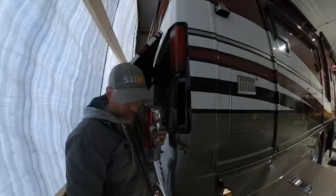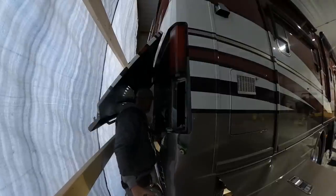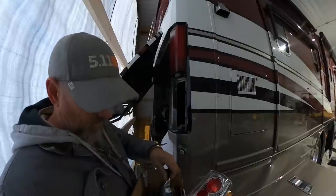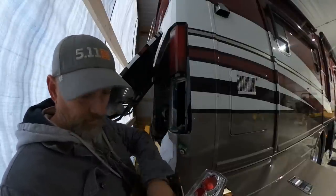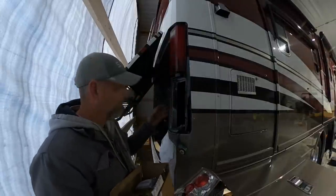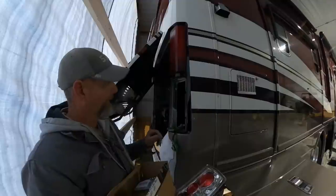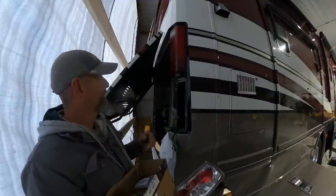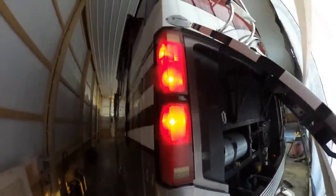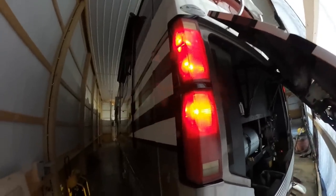When I pulled them I realized those are the old bulbs, so I ordered LEDs — 1156 and 1157 bulbs, plus the same blinker bulbs because those were so powerful back there. You can also use them as reverse lights. I fired them up and you can definitely see how black and messed up the old lens is — I think there's a bulb out on this side. The other side is a little brighter. These new LEDs going in here should get a lot brighter.